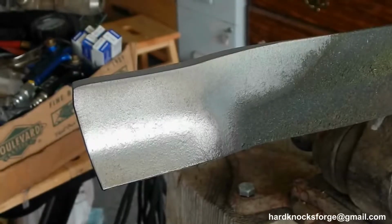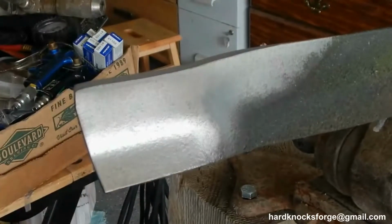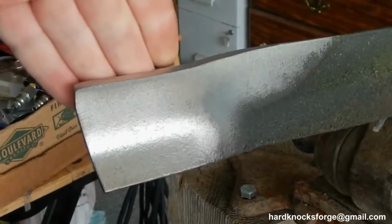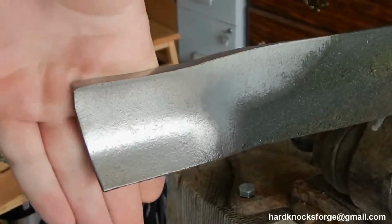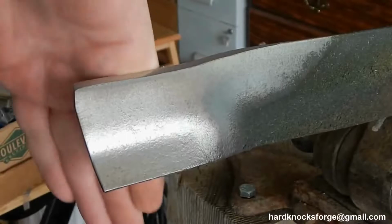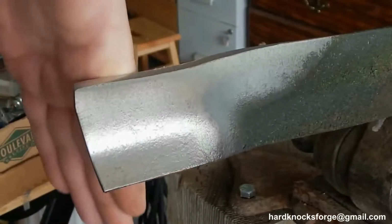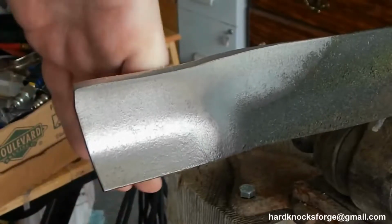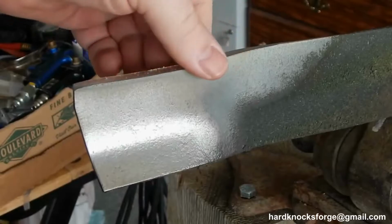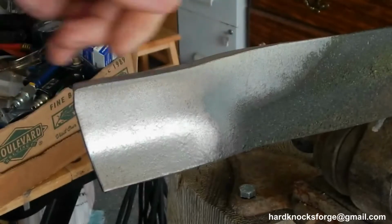One thing you ought to do when you're grinding this down, get this where you want it, then come back over on this side, and take one pass off real fast, get that burr off of there. And if you see that, that right there is I'm leaving skin on the blade, so that's way sharp cut grass. I mean, you don't need these things razor sharp anyway, they spin so damn fast, but still, when you can cut skin off your hand, that's plenty sharp. That'll last a long time, as long as you don't hit any more rocks.